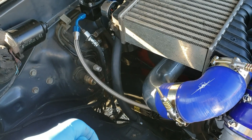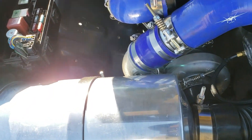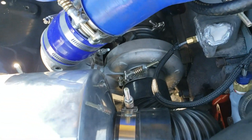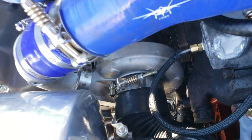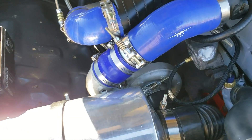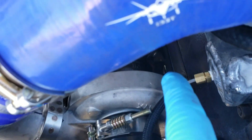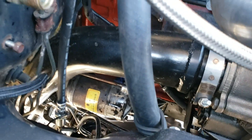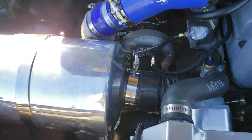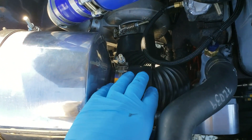It'll get the gases flowing better and might even help suck some of them out while you're driving. For the oil drain — you can just barely see it right down there — this turbo fit directly onto our oil drain that came with this motor, so that worked out really easy. We have a T3 spacer right there, and a three-inch downpipe. We also have a nice big Donaldson air cleaner housing with a flexible tube feeding into our turbo.